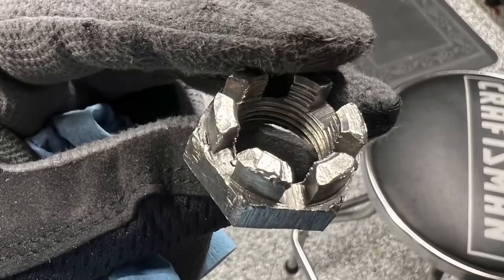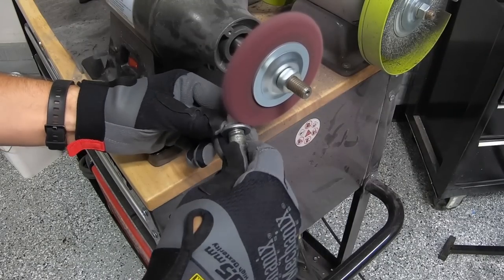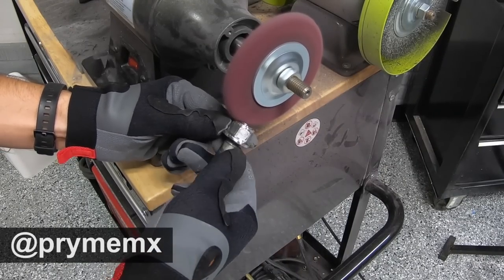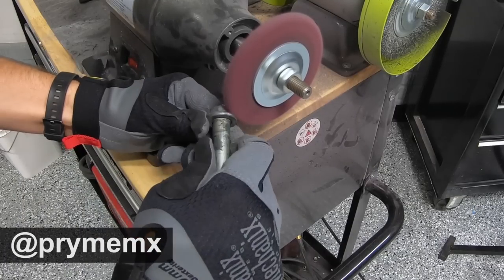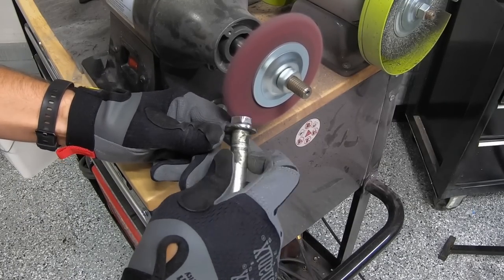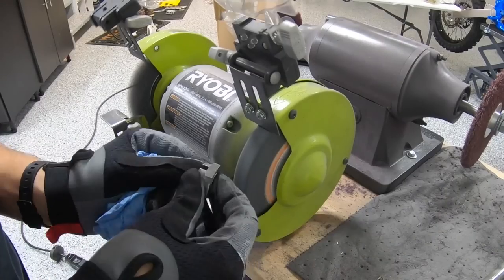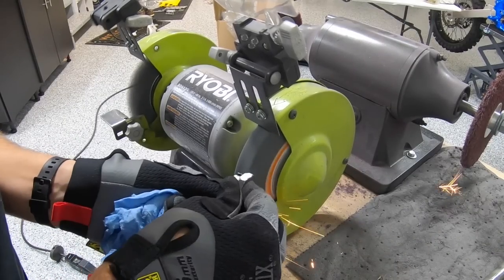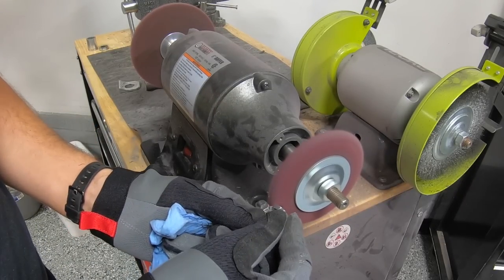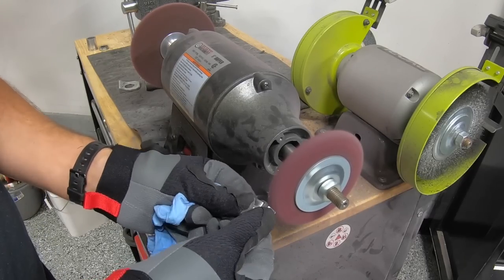All these bolts, a lot of these, like that nut, you can get new, but a lot of them you can't. So you're just going to clean them up. A buffing wheel like Prime has, Cameron Namella has these little buffing pads he distributes. They're really good for doing this kind of stuff. Like a Scotch-Brite type wheel. Wire wheels are good for the middle part of the bolt, but for the rest of it, on this bolt, I would rather get a new one on that nut for the rear axle. Some of them aren't too expensive, but the big bolts can be pretty costly.